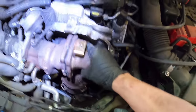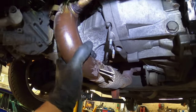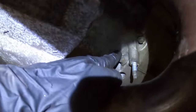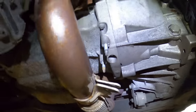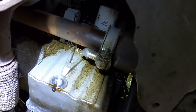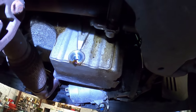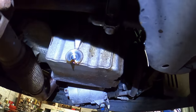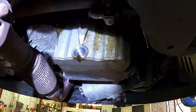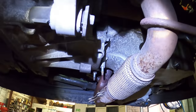The exhaust is all hanging down now, which gives me just enough room to tuck the pan out. There are 13mm bolts that go through the side of the sump into the gearbox, some hidden bolts up top, and then loads of 8mm bolts all the way around the sump. I left the driveshaft bracket on for now. Tip: if the job allows, get it in the night before, take the sump plug out and unscrew the oil filter, and leave it draining overnight — otherwise there's always a bit of oil running down the inside of the block.